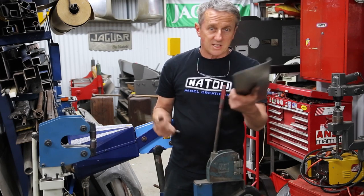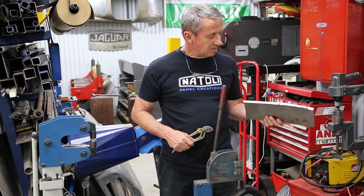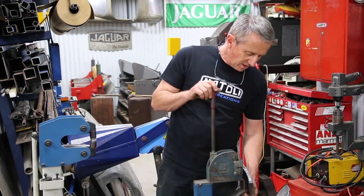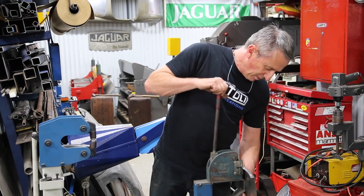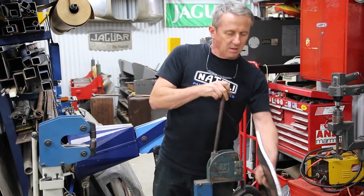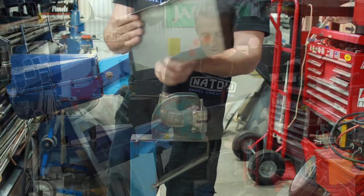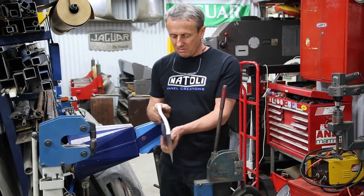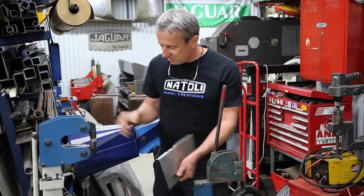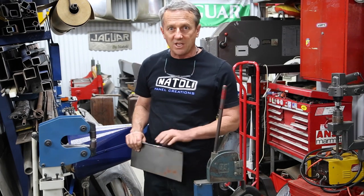Now if you've got access or you go out and buy yourself a couple of different types of shrinkers — this is the old one that served me well for many years. This is actually the stretching head on there. So you put the panel in there and push that and it just stretches it out just that little bit, which gives you a stretch on that side, or on the other hand you can shrink it. I've got stretching heads on this one as well, so we jump from this little hand-operated job onto a foot-operated stretcher. This one here has only got about 25mm, which is good for edges and stuff.